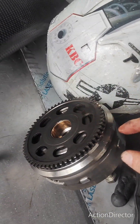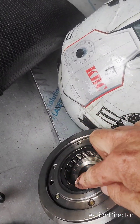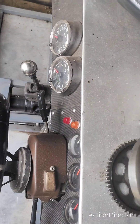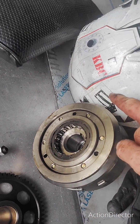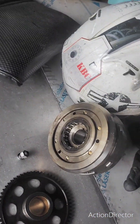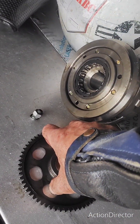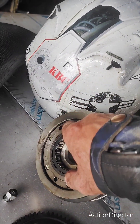When you go to AliExpress's website, this piece is there. The internal sprag is replaced by undoing 6 bolts like that, and then that whole piece there comes out. That's a piece of steel, there's a join in between, and that piece comes as one unit from AliExpress. You can order just the sprag, but it'll be a fail because it's the surface that's gone bad. For less than 50 New Zealand dollars you can order this whole gear with the bush, with the sprag, and with the carrier, and you just undo the Allen keys from the other side.